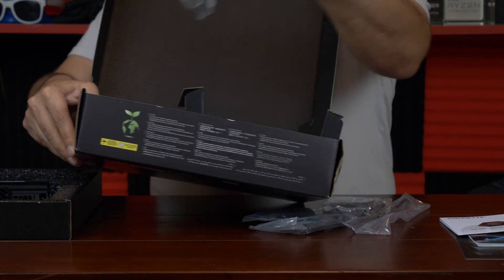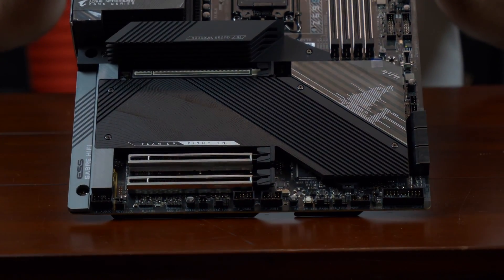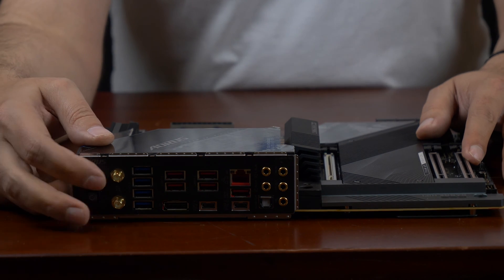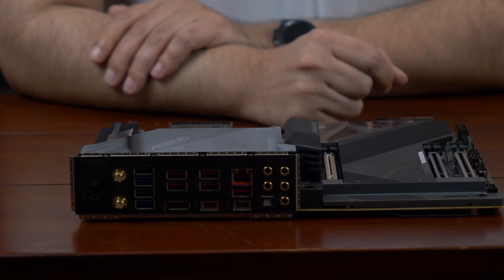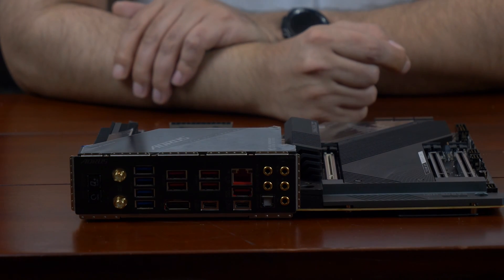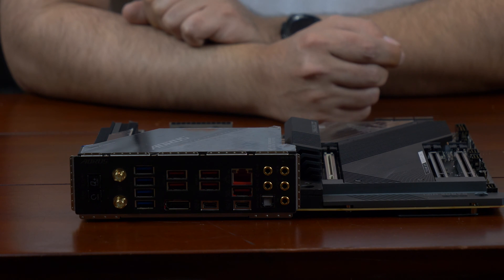This is actually the first time looking at the accessories. One accessory you're not going to see is the I/O shield. Here you can see the board — let's go at this angle so we can see a little bit more. Here we have our I/O panel, and here you have your clear CMOS button and also your Q-Flash Plus button. Underneath is RJ45 Ethernet, which is 10 gigabits per second from Aquantia. There's a USB 3.2 Gen 2 — what used to be called USB 3.1 — so a 10 gigabits per second connector, and that is also your Q-Flash Plus port. Underneath that is a USB 3.2 Gen 2x2, which means it's 20 gigabits per second.